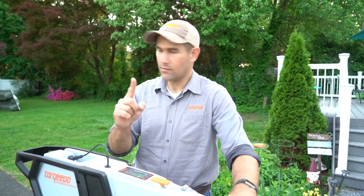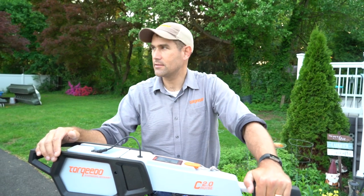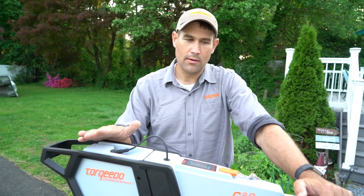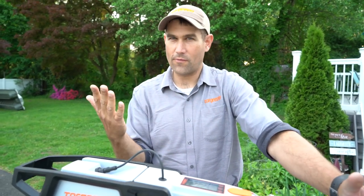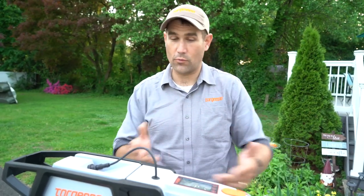But at 1%, if this boat can go 6.4 miles per hour, it'll go 6.4 miles per hour when it's at 1%. And then when it's done, it's done. Wow. So that's different than the lead acid setup. You can set these up with lead acid batteries and with non-Torqeedo lithiums. What I've found is that when you get the lead acid AGM batteries down to about 45% of the charge remaining, you can't use that bottom 45%. It just stops at 45%.